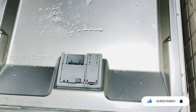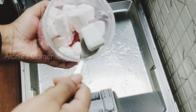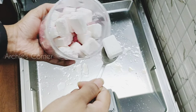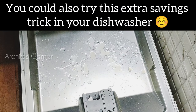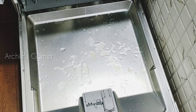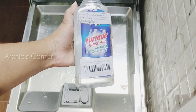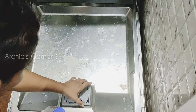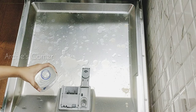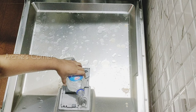This is the slot where detergent or a tablet should be placed. It is recommended to use one full tablet, but we cut the tablet in half and have been using it this way for the past couple of months — the wash quality remains as good as using one full tablet. We need to fill the detergent or tablet for every wash, just like a washing machine. The slot next to this is where rinse aid should be filled. It is a special liquid used to reduce the surface tension of water so that water won't stick to dishes during rinsing. This actually makes a lot of difference to the final wash quality, and we refill rinse aid every 10 washes on average.